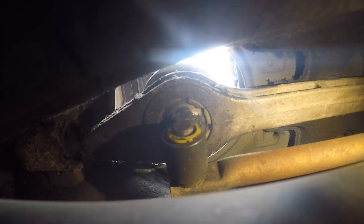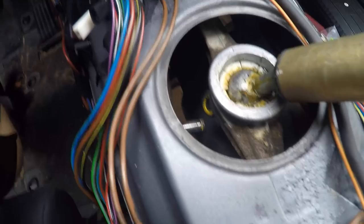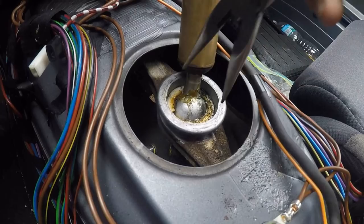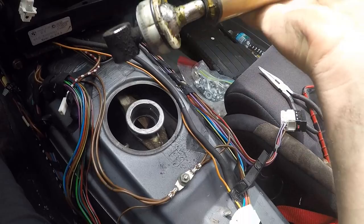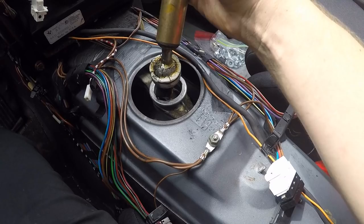The pin is all the way out now. I'm going to grab some pliers, spread them, push down, and then shift it clockwise to get this off. We're going to jam them in the best I can and twist so it comes up. I've seen a lot of people use a flathead and beat it out, which ruins it and could possibly ruin your car. This is the easiest way — you push down, twist clockwise, hear it pop, and it pops right out.